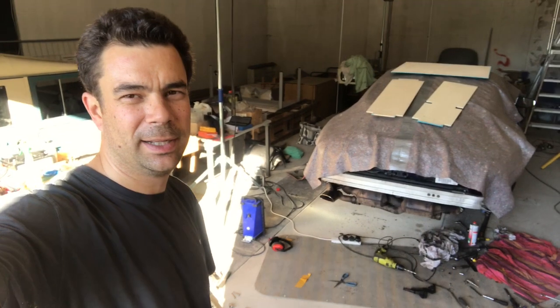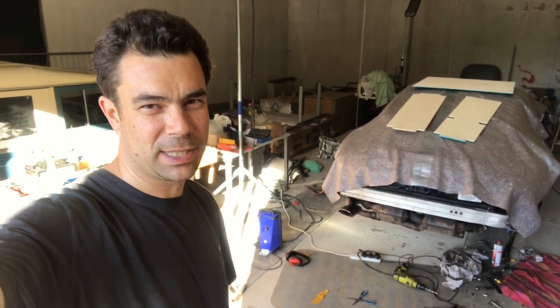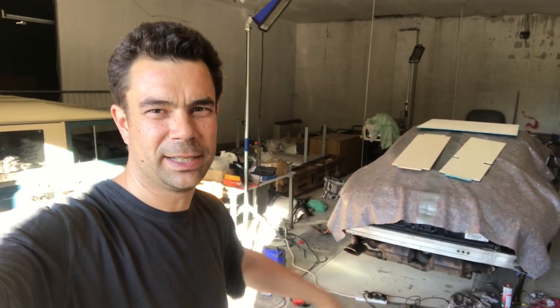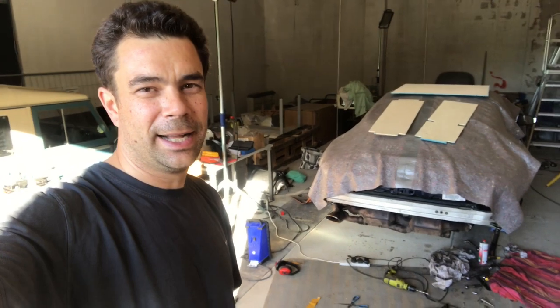It was going pretty well, but then I snapped a couple of bolts. I have three snapped bolts so far: two on the rear support for the catalytic converters, which are slightly easier to get to, but also one on the driver's side silencer bracket, which fits to the engine. So there's a snapped bolt in the engine block, which is really annoying.